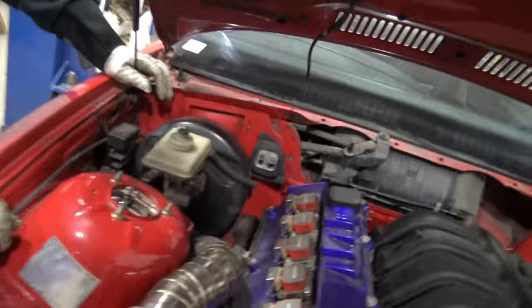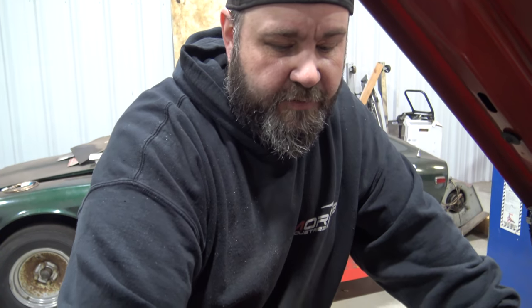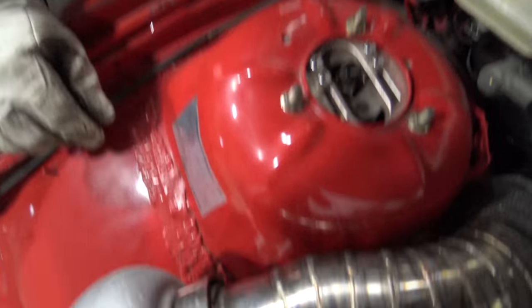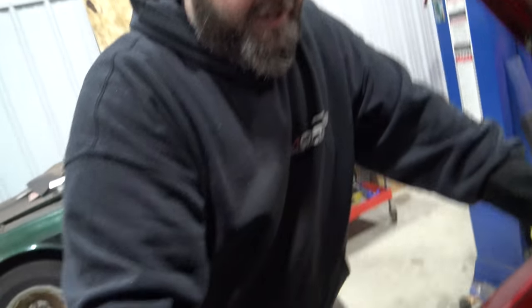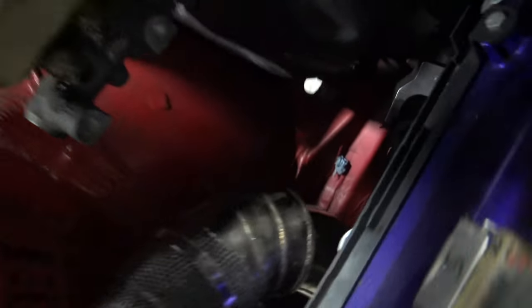We're cheating just a little bit. We got pretty lucky - the turbo setup I bought actually came with a pretty nice custom downpipe already, but of course it was for a left-hand drive car. We're actually able to utilize a good portion of it - basically the whole portion that goes around the strut tower. This saves us quite a bit of time. I'm actually happy that this V-band is here because these V-bands for precision turbos are ridiculously hard to find. So thinking we cut a couple pies off here and add a few more, we can bring it all together.